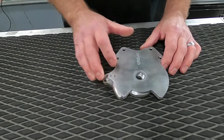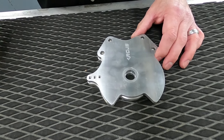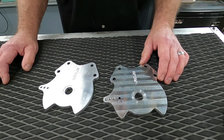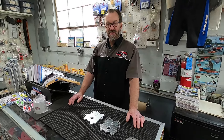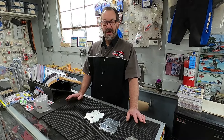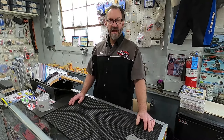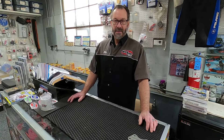We also make one for the 2021 Superjet, and it's different again. People are putting these older systems on the newer skis and you're bottoming the cable out before the steering stop hits. Unless you're making some adjustment to the steering stop or some modification where it hits, it's way too wide and you're going to have trouble. Or you've got to run the cable in so far that you're not getting the advantage of the quick steer — so why change the plate out if you have it set way to the inside? You're not changing that ratio.